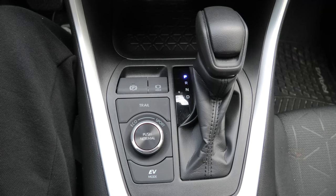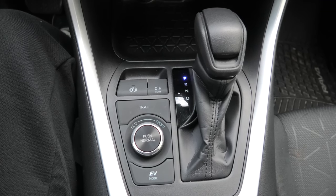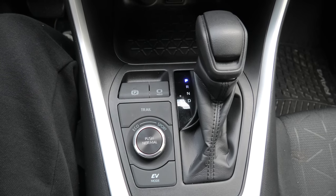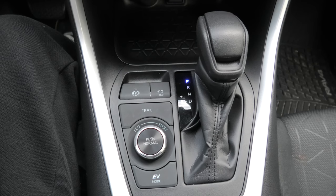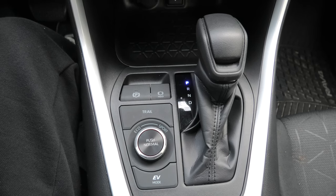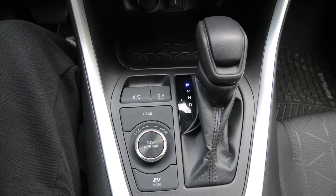This mode can be useful in winter when you park the vehicle. In winter, the parking brake may freeze up, preventing it from being released. That is why you may choose not to set the parking brake in cold weather. If you do it this way, make sure to block one of the wheels with wheel blocks so it does not accidentally roll.